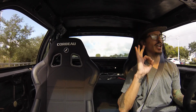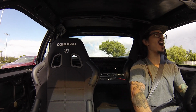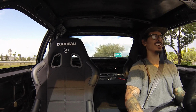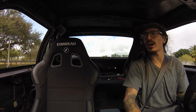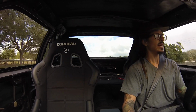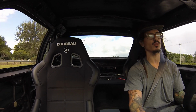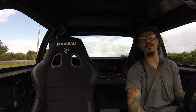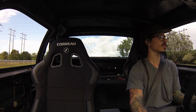Pressure after all those pulls, so that's a good thing. Woohoo! Our first race in Miss Parker, boys! Man, that's sick. I definitely need to heavily consider getting an ECU for the car and having it pro-tuned because it's still only going down to like mid-13s as far as air fuel goes, which is not ideal. I'd rather have it like 11.5, 12s. But it's just not getting there. I don't know why. Probably because we don't have a tune.